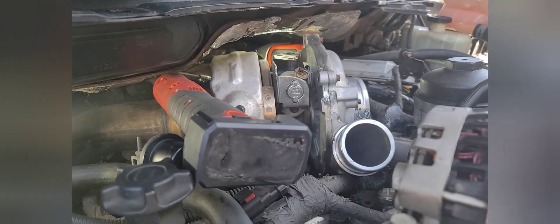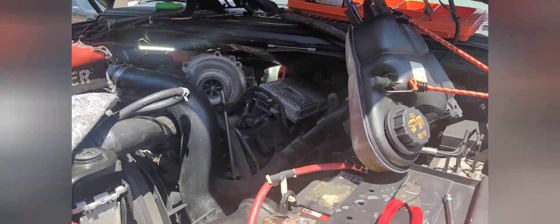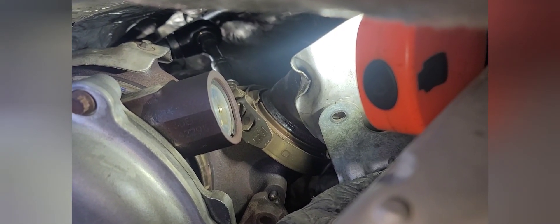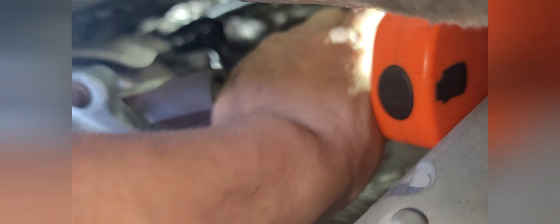My setup to take off the last clamp: a two-and-a-half to three-inch three-eighths extension, a deep 11mm socket, and whatever ratcheting tool you're using. I would typically use a quarter-inch just because it's a little smaller. Hold the back of the clamp so it doesn't pop out while you're spinning, spin it out — there you go, right there, you'll see it coming out.